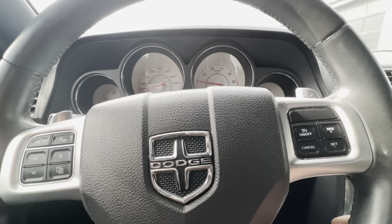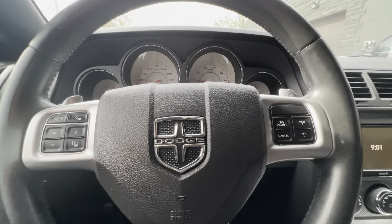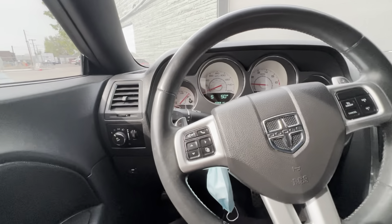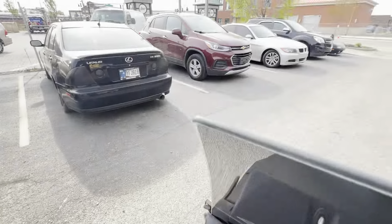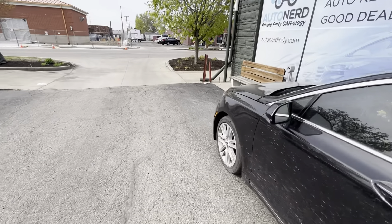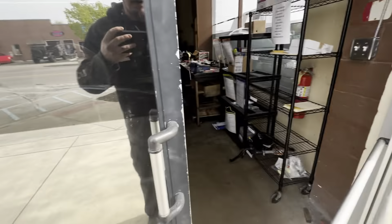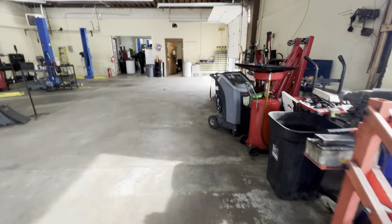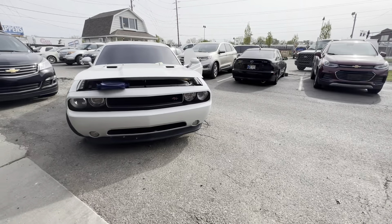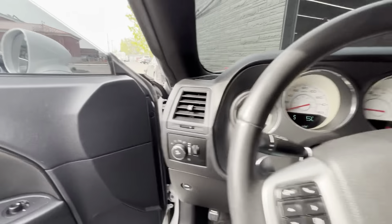The battery jump box is still hooked up. They don't even have a charging gauge on this thing. I'm going to get it pulled into the shop — suspecting a bad alternator. That was my own stupidity for going straight to checking if it was locked up instead of checking the battery first. Expecting that a customer knew what they were talking about — that'll burn you. But definitely not locked up.